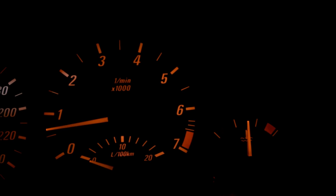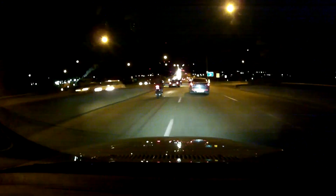When you're idling your engine and it's just sitting, it should heat up to the 12 o'clock position in about three to five minutes and it should stay there — not go above it, not go below it. Even when you're driving it shouldn't go below it.